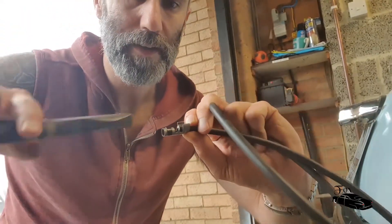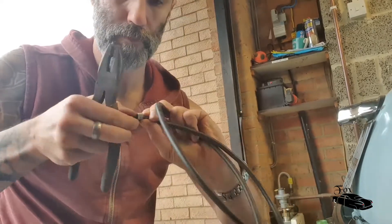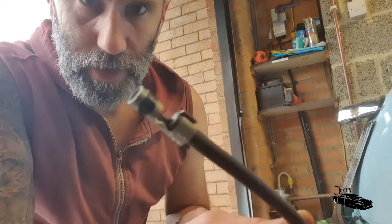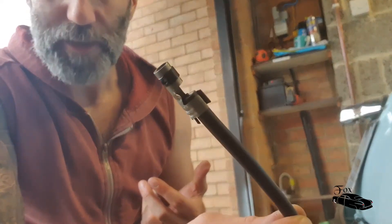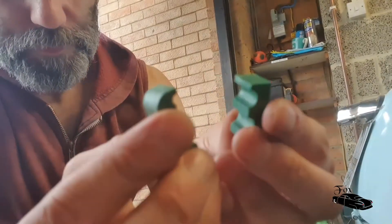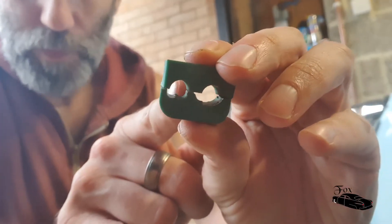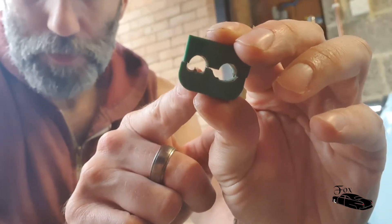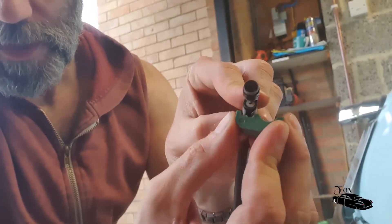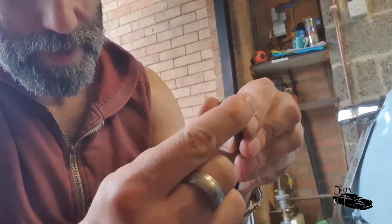So I don't have to have loads of hands for the next part, I'm just going to use a standard pair of pliers to start getting it crimped over a little bit - that way it will hold itself together when I try to put it in the set of dies. The dies are quite simple: you have two sets of plastic dies and the only one we need is the one with the groove running up the middle, because when we compress it in the vice it will push the two open ends inwards and form the crimped end, holding it all together.